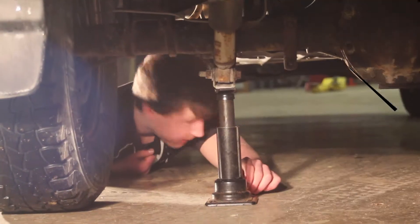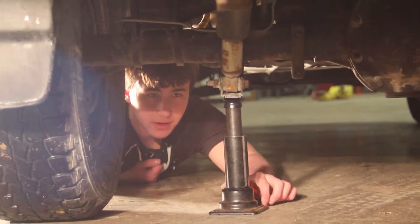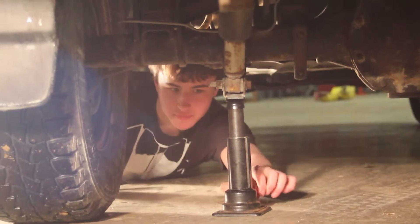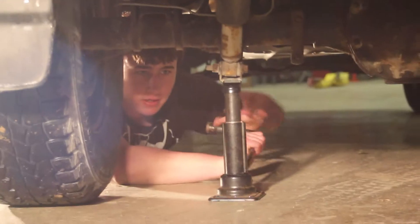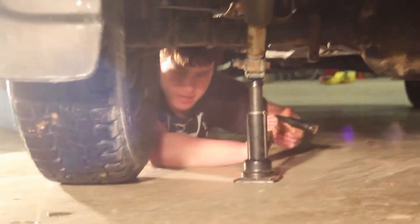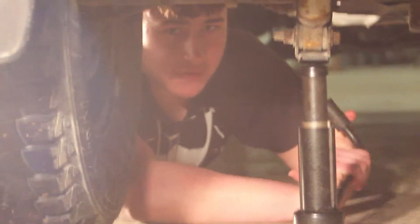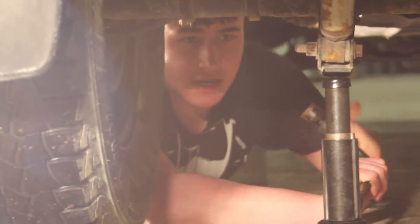Alright, we've got to jack the truck. We're going to find a nice sturdy spot underneath it, get it positioned, and if it gets difficult, put this in here and start raising it up. You're going to want to raise it up enough so that the tire is off the ground. Now, even though this tire is aired up and you have a flat tire, chances are it will be lower to the ground, so you have to raise it up even more.